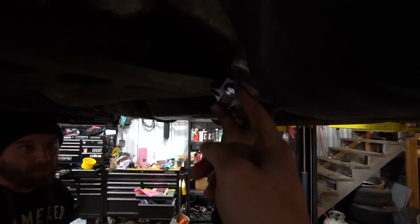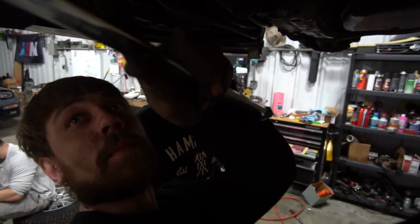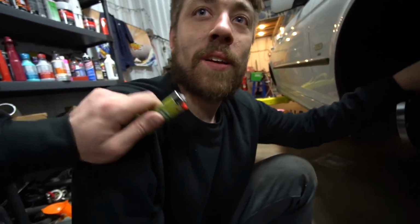So this is gonna actually move the control arm back and forward to adjust caster to help with the self steer. Yeah, it moves it in and out, which in turn moves it back and forward here. That's gorgeous. And the extended lowers will give more camber and more track width, which is perfect. Why'd you pull your tire out? Just so you can get to your tie rods. Well, I have brand new ones. You need longer tie rods because you have longer control arms. Wow. Yeah, I don't know how much longer. I have tie rod spacers, but I don't even know if I really need them.